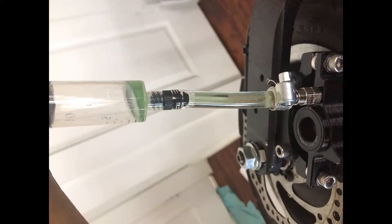As you bleed — as you pump the brake lever — you have to squeeze the flange at the same time, and you have to squeeze in hard. There's going to be a lot of resistance, a lot of pressure wanting to go up, so you have to force it with your hand to press and squeeze the flange. This pumps to increase pressure, helps get the fluid injected into the brake line system, and at the same time gets the bubbles out. It does both at the same time — both pumping action and extraction of bubbles — while you squeeze the brakes.